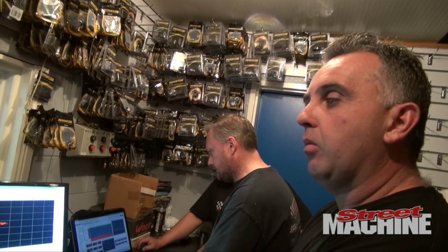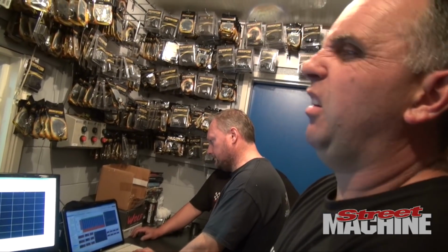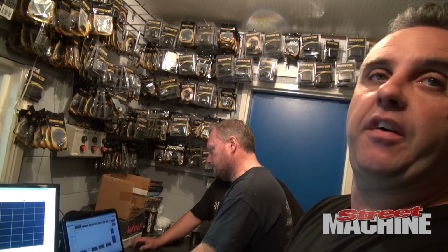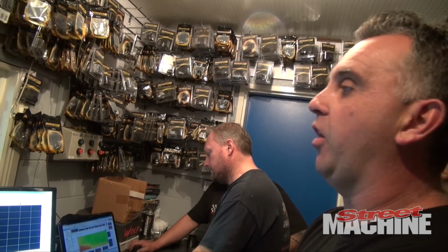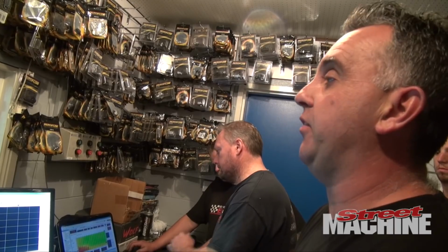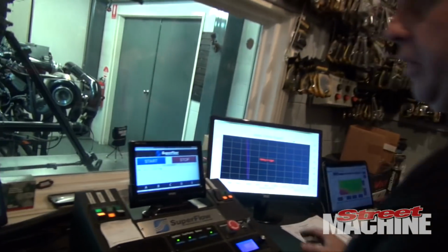What's the most you saw out of this with just 98 pump fuel? It made 1700 horsepower on about 15 odd PSI boost, I think. 16, 17, something like that. With 98 octane BP, that's what we normally run. But the race fuel just gives you a little bit more safety margin. We put race fuel in it, the exhaust temps have gone down, just safer. You could probably be a hero and run it on pump. I run my stuff on pump, about 24, 25 PSI, and it lived for a long time, 8, 9 years. But the customer wants it to be safe, so we'll run it safe. It's a smarter thing, I think. You put more fuel in there? Yep. It might go up a pound of boost here, hopefully.